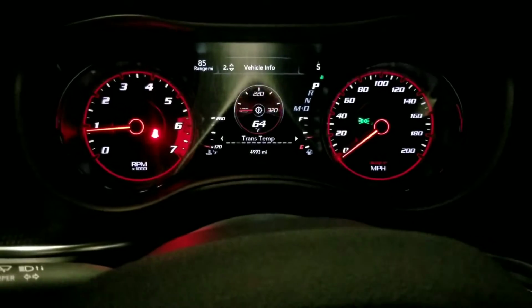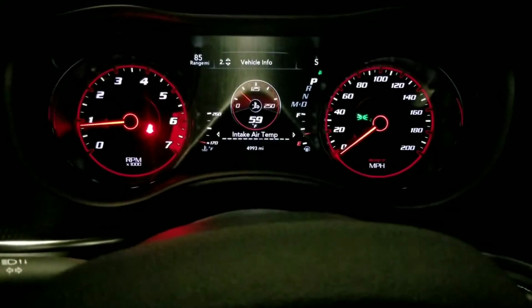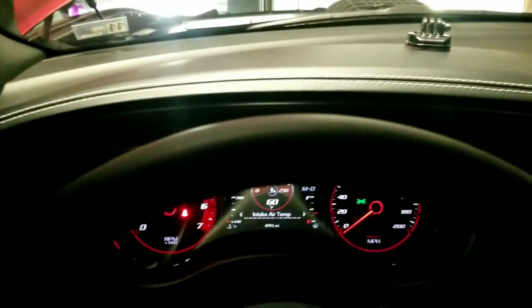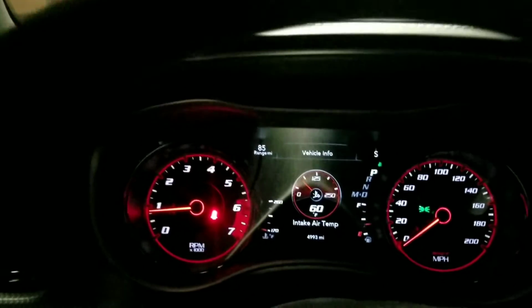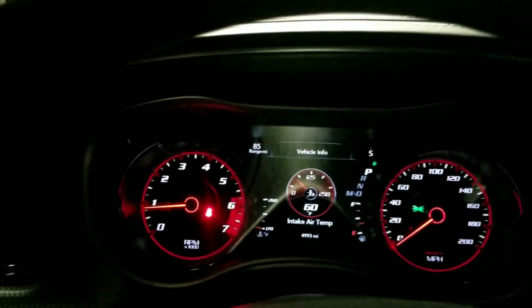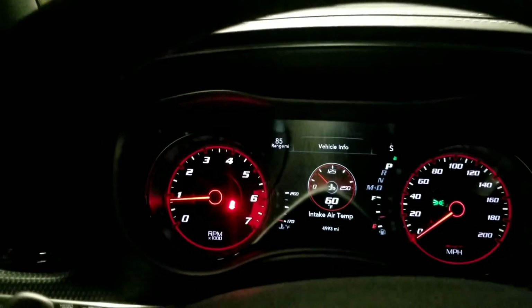ITs, just check them real quick, make sure it's reading, everything's connected. Come on. Got 59. The hood's still up, by the way. Just double check. Yeah, it's reading. Went from 59 to 60. So I'm gonna let her warm up. By the time I come back out, we should be good. I'm gonna take a test drive, see if anything pops up.